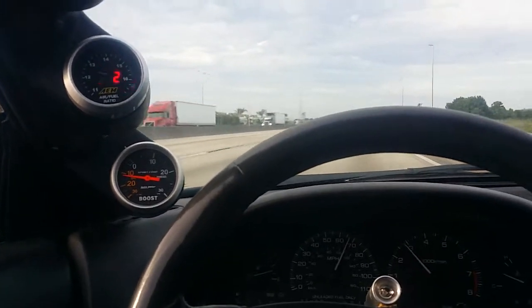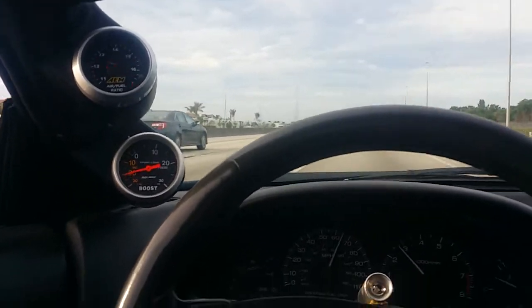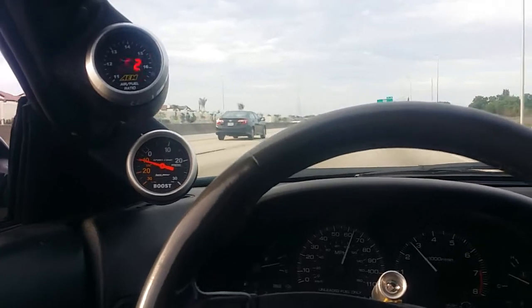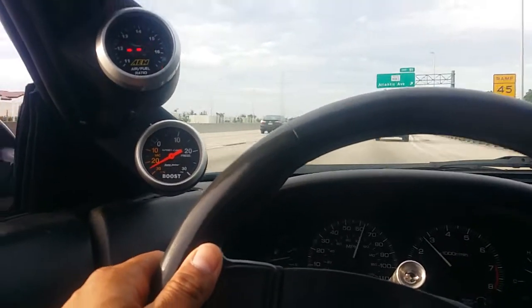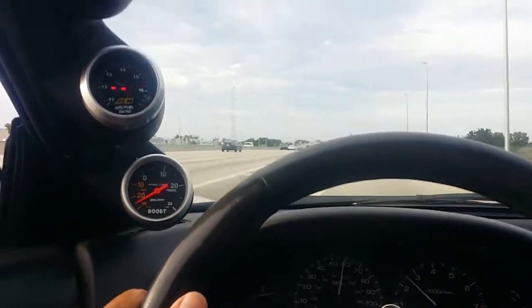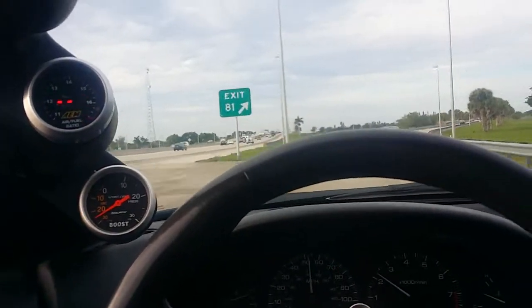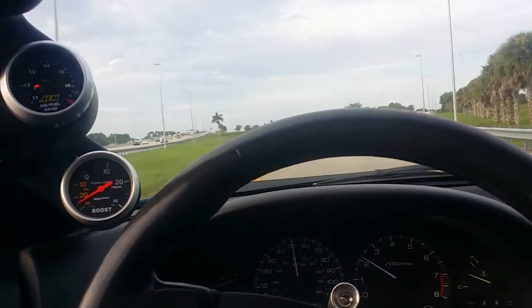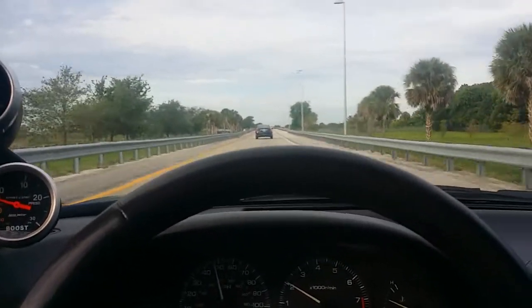Hopefully if I race against a decent-sized car, this 34 pounds might do well. But on another given day when it's a little cooler out — because I'm running open loop — with these same wastegate settings I could drop down to like 26 pounds. This is why you have your closed loop wastegate duty settings.